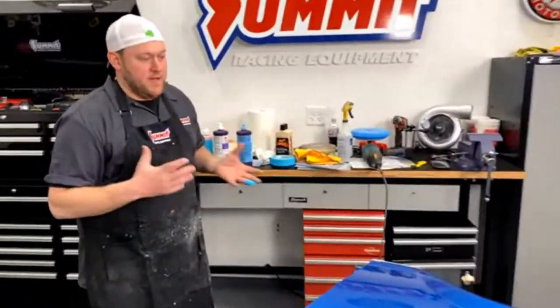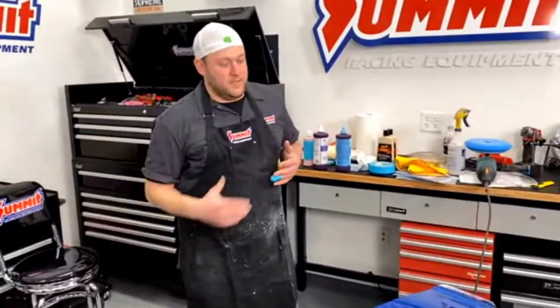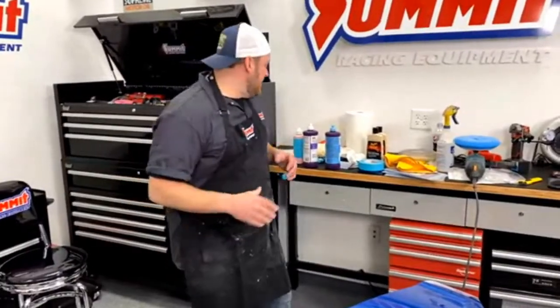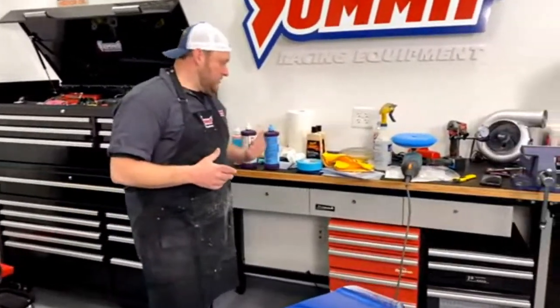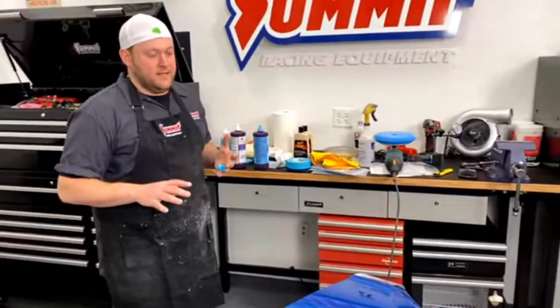Although with polishing metals, you're going to start with a heavier grit. So you're going to start with like an 80 grit maybe and go up to 3, 4, 5,000, because the further you go out, the less scratches and the shinier it'll be. You can also use rubbing compounds. They work, but they'll still leave fine scratches in it.